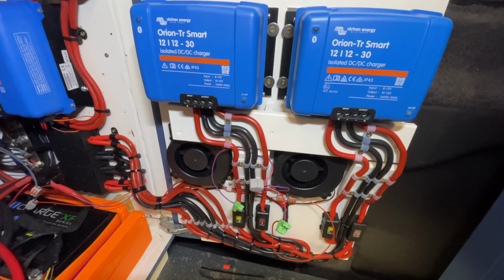Let me pop to the back and connect it to this one. That's currently charging at 68 amps, so that's 68 amps charging from these two 30 amp chargers. Because they're currently in startup mode, after they begin to overheat you would generally see them drop quite a lot. Because I have my active cooling on, even after 2 or 3 hours I will maintain a 65 amp charge.